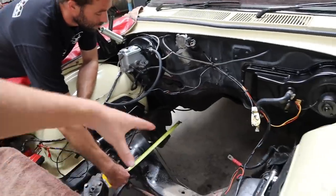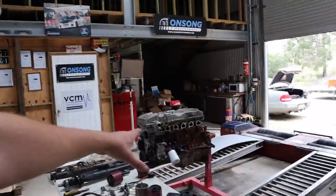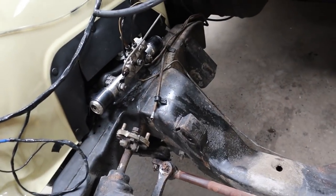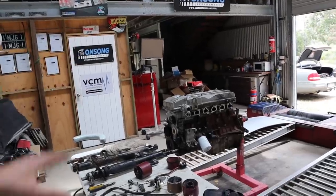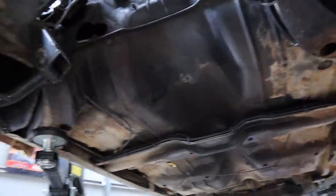That's pretty much here ready to start getting washed up and put together. However, due to time constraints of how little time we have to get this thing to fab, we're not too fussed about that engine at the moment. The plan is to get this ready to go to fab, and once it's out of here and at the fab shop, we can worry about getting that engine built. Through measuring, we've come to a pretty good conclusion that where those mounts sit on the engine is nearly directly over the stock mounts on the cross member.